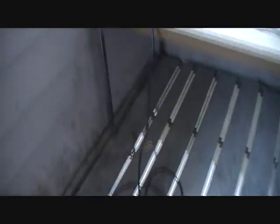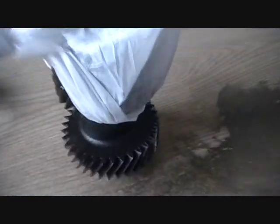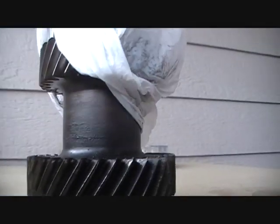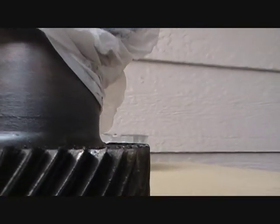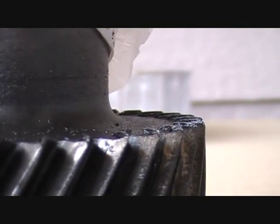Here you can see I am getting ready to grind this gear and remove the burr that is on every tooth. You can see it clearly here, how it sticks out, and we believe it's making the transmission whine. So I am going to do this now.